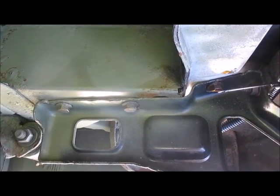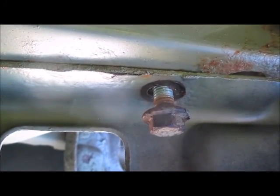Let me see how hard this is — I might need a breaker bar. Oh my god. Believe it or not — righty-tighty, lefty-loosey. I don't know if it was because I put the PB Blast on early this morning, but these things just loosened right up. So before you do the job, go ahead and put some PB Blast on. I put it in between the holes and shot as much as I could in there. I think I used about a quarter can of PB Blast, but I let it set for about an hour, hour and a half. I cranked it like 50 bajillion times — it was just a little rusty right there, but I really don't want to use the impact on it. I know it'll come out faster, but I don't want to strip anything. I got them out.